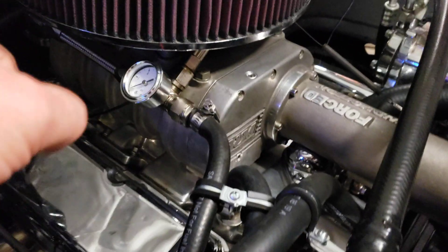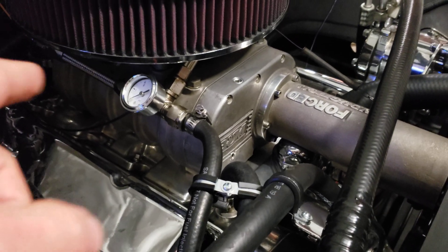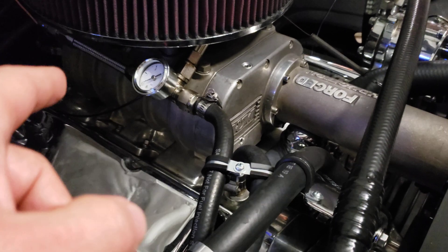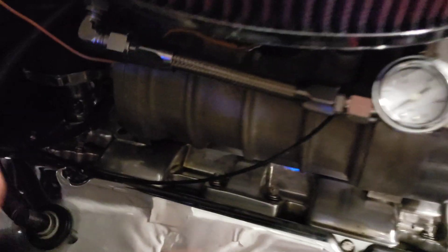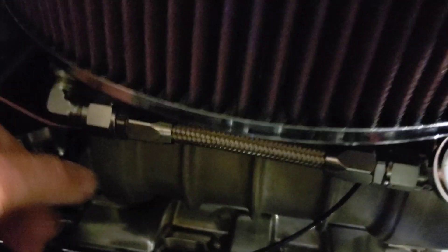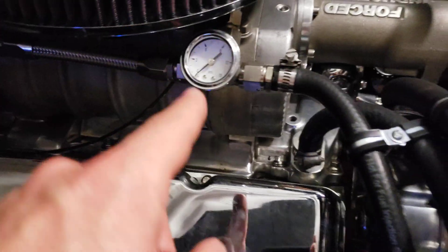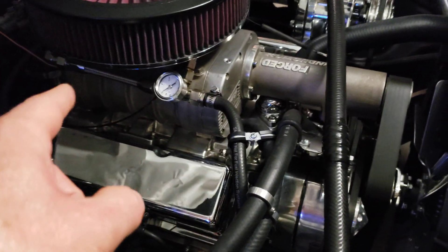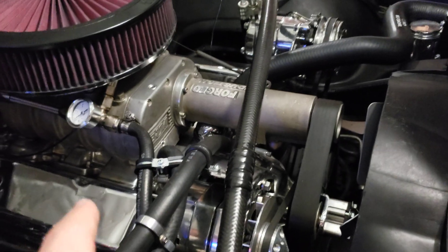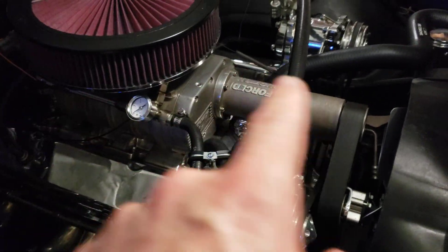There are two things to look at. There's a backplate where there are greased bearings. That part doesn't require much servicing — those bearings are packed with grease, much like a wheel bearing. You'd have to put a lot of miles on the blower to really need to change the grease. You have to remove the rear plate to repack those rear bearings, but that's not something you're going to have to do very often. If you happen to have the blower or carburetor off for any reason, I'd go ahead and do that servicing then, but I wouldn't go out of my way just because.